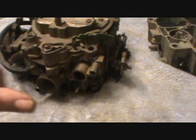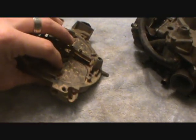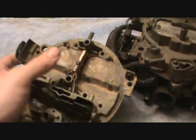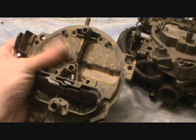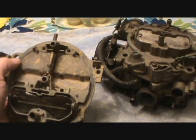This is a non-electronically-controlled Quadrajet. These did not begin being controlled electronically until sometime during the very late 1980 model year — you would know it because it has electrical plugs, which this one does not have. Now, to begin with, I have a couple different things laid out here. This Quadrajet is what's called an air valve carburetor, meaning airflow into the secondaries is admitted by these two flaps on top of the air horn, called the air doors. This is not a vacuum secondary carburetor — anything you know about Holleys, just throw it out the window.